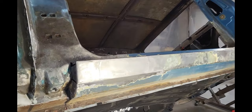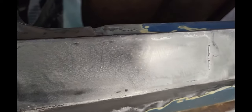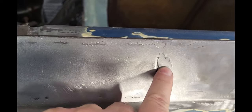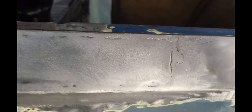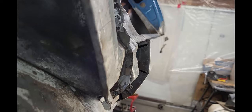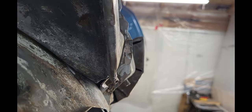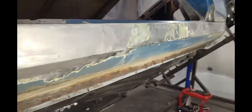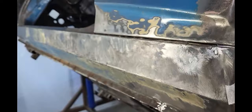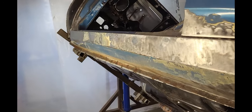After a little quality time with the welder and the grinder I got her all welded in there. Looks pretty good — it had a little burn-away that I had to fix up, but other than that it's looking pretty good if we look down the line. You can see the body lines are still pretty good and it looks pretty flat in there. I also welded up all these holes and stuff, so not too bad for a shitty old car.